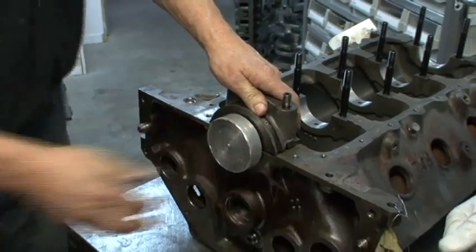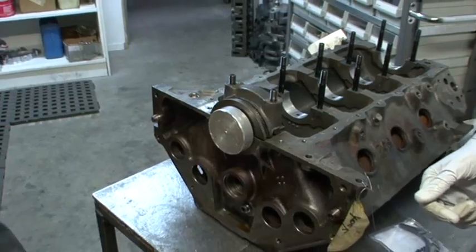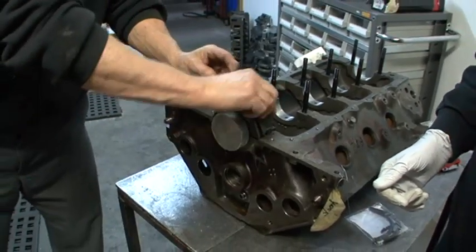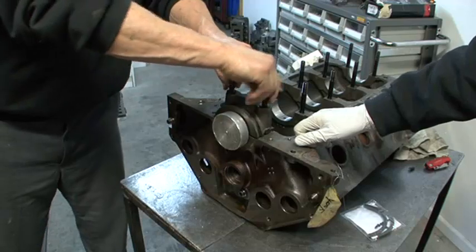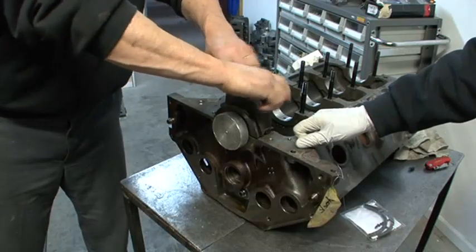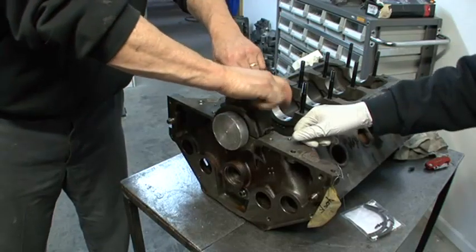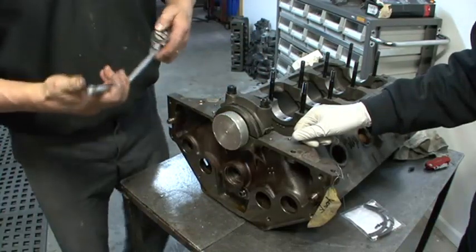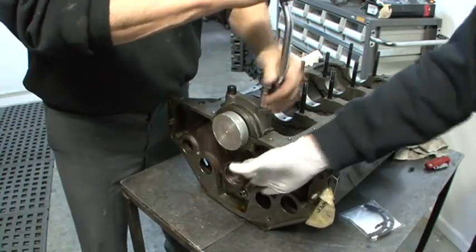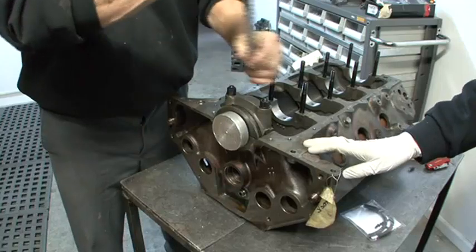You can see that we've made a mandrel which is basically the same size as the crank seal area. He'll torque the cap up to crush it and position the seal as firmly as possible in both halves — in the block half as well as the cap half.